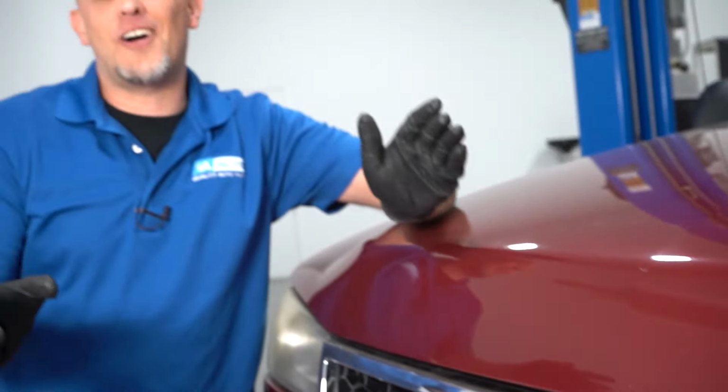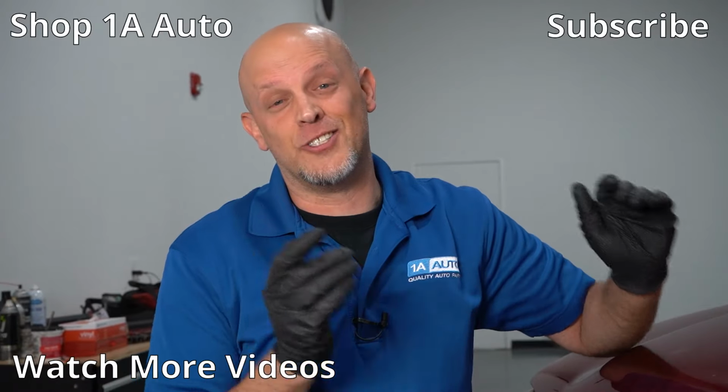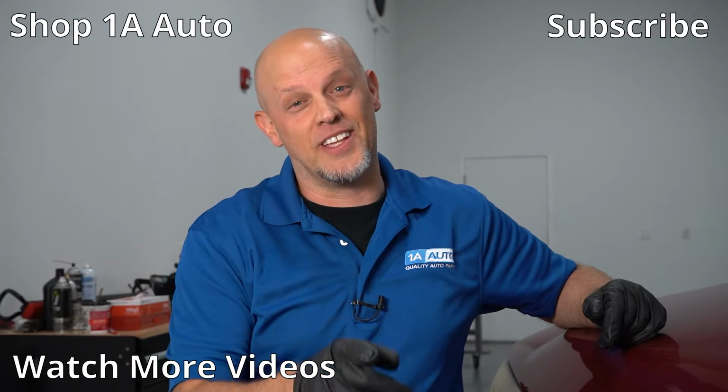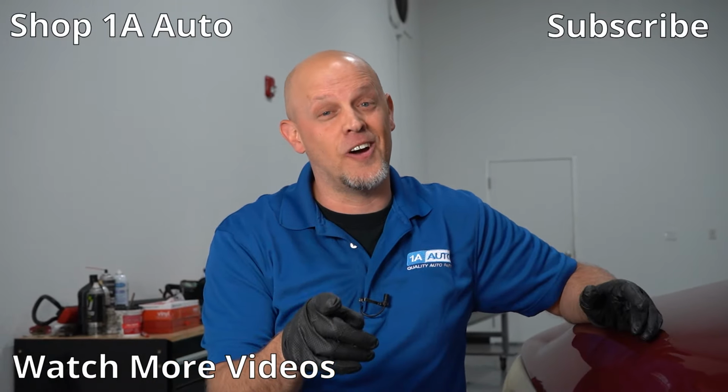In the event that the fuse is blown, most likely there's another condition, whether it's the sockets that are bad or there's a wiring problem. Fuses don't just blow on their own. Also, if they're both burnt out, it could be the ambient light sensor, whether it's disconnected or it's just a faulty sensor. Now that I've talked to you about daytime running lights on GM vehicles, you're gonna notice all over the place every other GM vehicle with a daytime running light out, and you're gonna know how to fix it.